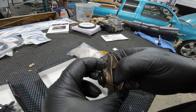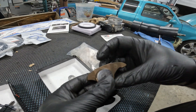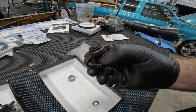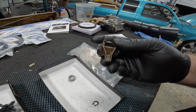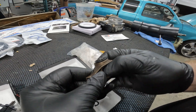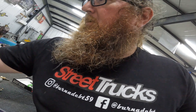There you go — you now have a nice upgraded trunnion rocker arm. These are pretty heavy duty. They say on the internet these factory rocker arms will hold north of 650 horsepower. I'm not sure how you rate horsepower with a rocker arm — I'd think spring tension is what would kill it — but you can definitely feel these are a lot tighter than the factory setup. You can tell it'll reduce a lot of valvetrain stress and maybe allow a couple hundred more RPMs. Most importantly, it'll keep all those needles from adventuring down into your oil pan.